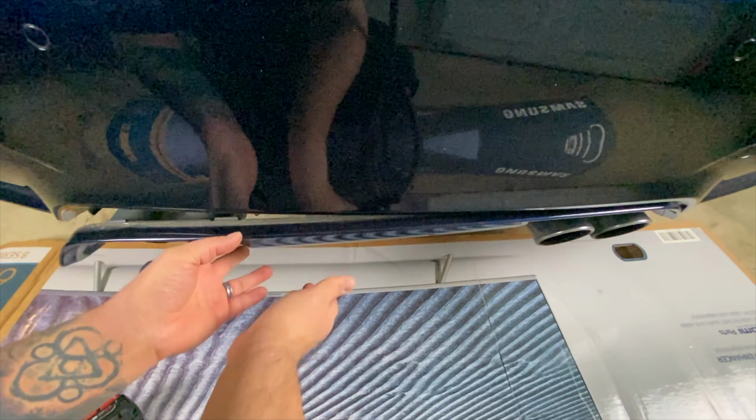All right, I'll show you how. I had to break out the jack to actually have enough room to get into there and drill. So go ahead and jack up the car. Obviously don't work under a jack that's not supported by anything else. And as you can see, the jacking point is that block there. You might want to get one of these aluminum BMW jack pad adapters. It fits into that block, so you can jack it up without damaging anything.